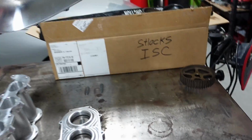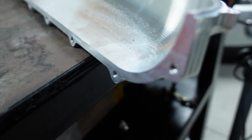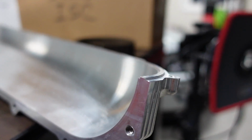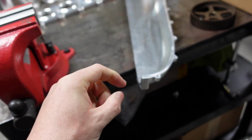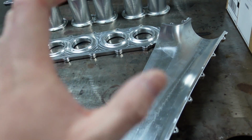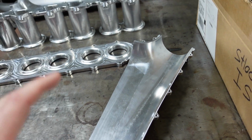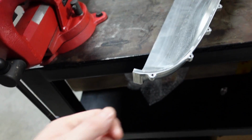On the male side, and what I mean by male side is this, let's sit this down, trying to find room here. Even though it's getting powder coated, I'm trying to be gentle with it. The male side, you can see, let's see if it'll focus. See how it sticks up there? It's not just flat and flush here to press down. It actually sticks into that C groove to really give a nice tight seal and push down on the actual O-ring. Same thing here. I really like that. That really helps seal this thing up. When we were trying to pull it apart, me and Colton were like, damn dude, I can't get it apart. So it really is in there tight. I like that. It keeps it from coming apart.